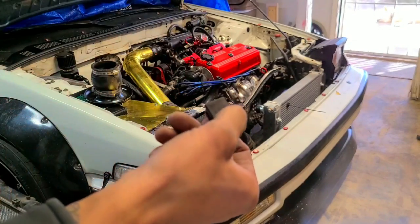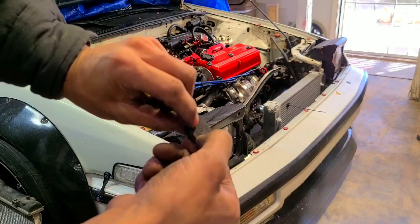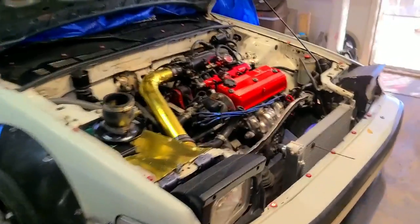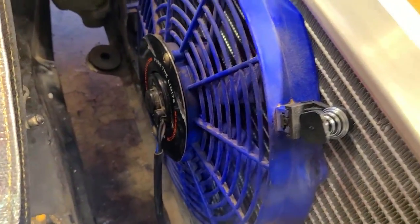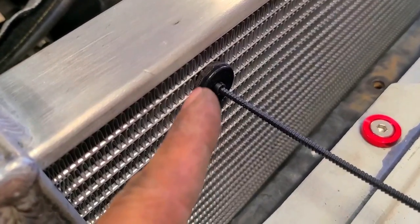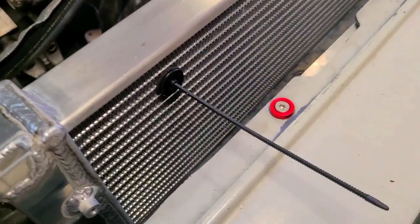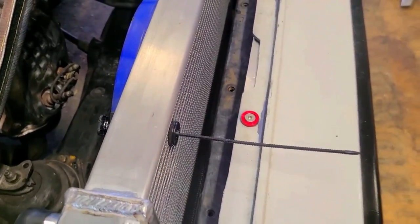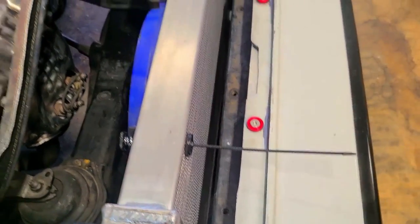On this little piece, you see where it protrudes out - that's going to face toward the front bumper. The flat side is where the foam pad goes. The soft, non-adhesive side is sandwiched onto the front of the radiator. These black clips just slide into the electric fan. The adhesive is square - make sure to cut and trim all the sides so it's not blocking the fins. Then just tighten it to where it feels right and cut off the excess.